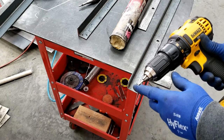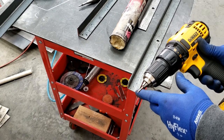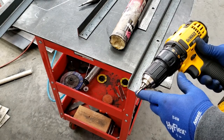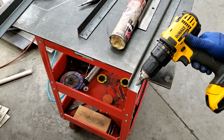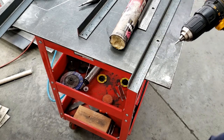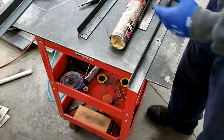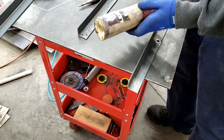They have a very fine tip, a drill tip on them, and then it bevels up for a leading edge for your drill bit. They're rigid, they don't flex, they don't walk off. If you center punch a piece of steel like this, it will stay in that center punch, unlike a drill bit that'll tend to want to wander around and walk off, because drill bits are flexible.